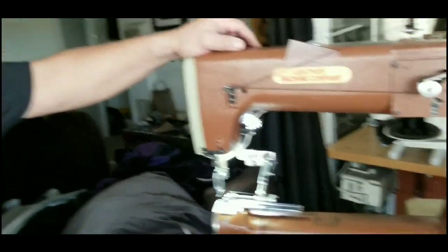It's got inconsistent density — is that what you're saying? Yes. This machine is typically tuned up for that. You tested and it's continuing to do the same wrong thing. What size thread? The same 346 with the 25 needle we normally use. You didn't change anything. Okay, so now we're going to do a quick inspection of the timing. Did you break a needle? No.